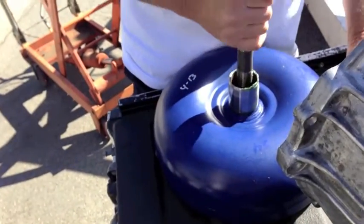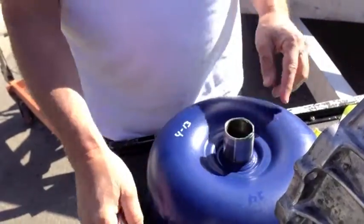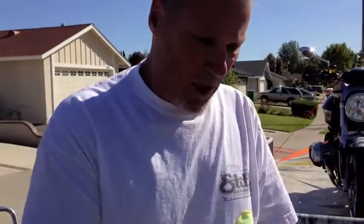Because I don't have a 29-spline input shaft loose to stick in the converter, I want to make sure they didn't accidentally give me an FMX with a 31-spline C6 input. If we put that in with the smaller spline shaft, you'd fire the car up and it wouldn't move — the pump would operate but there'd be no application through the input shaft. So to test it, I'm going to take a 31-spline input shaft and try to put it in. It doesn't fit, so we have the correct converter.